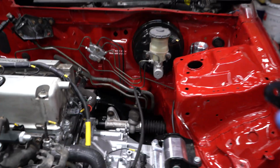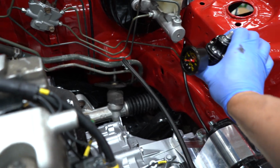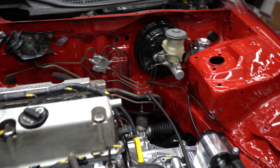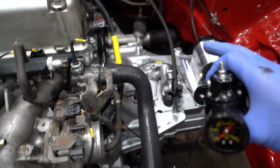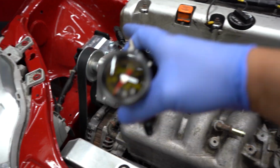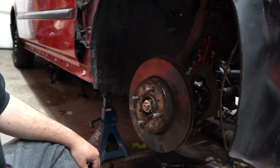And they say when you mount it, you have to mount it on the shock tower right here. So we're gonna mount it on this shock tower here, screw some holes, get some bolts and nuts, and put that guy in there. And then the one line will go into it. One line will go from this fuel regulator to this side and out that way through the fuel filter. And pretty much the system will be complete. So this guy's just gonna dry for now. And Alex is working within the hub over here.